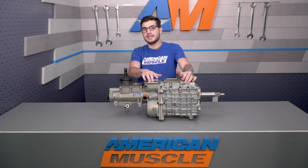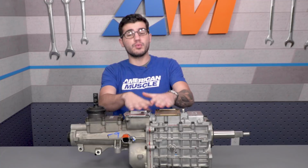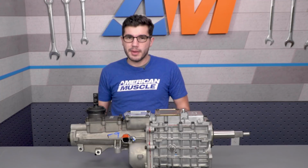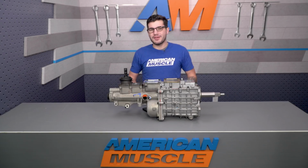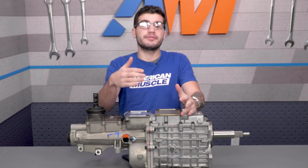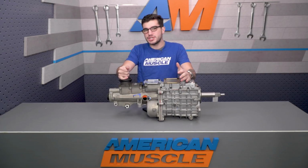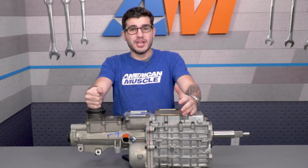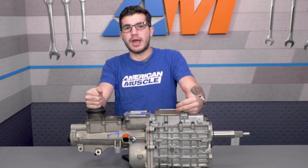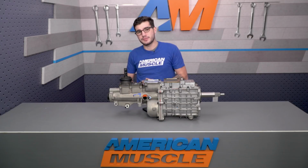The quick fix for this, and frankly I'm sure you'd be doing this anyway, is to pick up an aftermarket shifter, which will do wonders to make your shifting experience better. Personally, I think the pros outweigh the minor inconvenience of noise and clunkiness any day. I mean, after all, the older Foxbodies and SN95s already came with the clunky and notchy shifting experiences with the T5. You really get to feel each gear you're grabbing, and with this, you can do exactly that without blowing your trans at higher horsepower numbers.